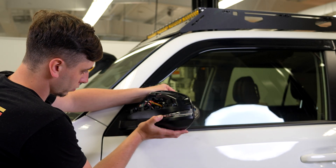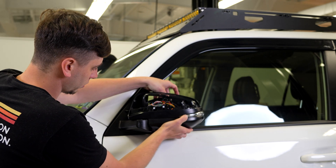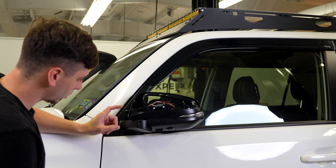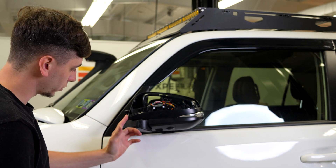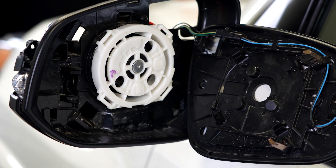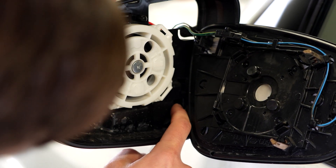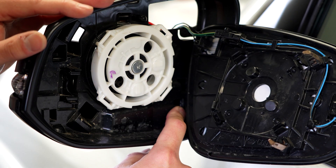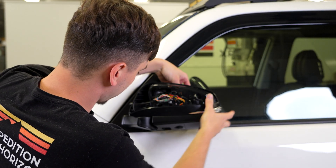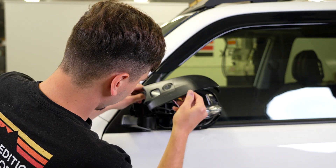For the next one, move the mirror in like so. You're going to have a clip right here on this very edge, which is pretty easy to get out — just push a little bit and it'll pop right out. You're going to have one more clip right here inside this hole on the mirror housing. Put your screwdriver in there, press it, you'll hear it pop. Now we can fold the mirror back over and this will come off.